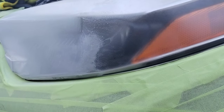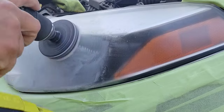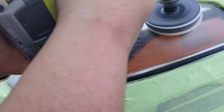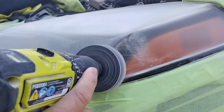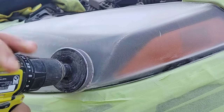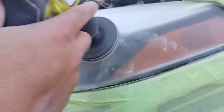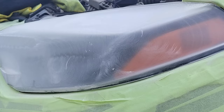With these headlights, they're extremely soft. When you're working on mid-level or low-level soft headlights, you really don't want to apply too much pressure. If you apply too much pressure, you're going to have a lot of scratching and different things going on with the headlight that you don't want to fix at the end point. Those heavier-duty lights — on bigger vehicles like F-150s or those larger Kias — take a little bit more pressure to get all the damage and erosion off.